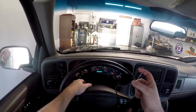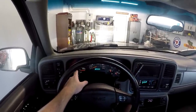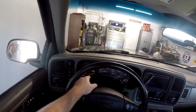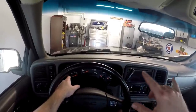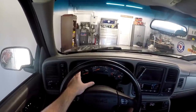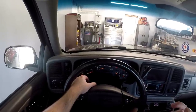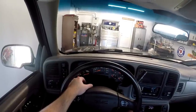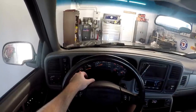There's an impact sensor up under the radiator support, and they like to corrode. So what you have to do is turn the truck off, disconnect the battery. I'll disconnect both batteries because this is a 2500 with dual 12-volt batteries. Then I'll go under the truck, take off the skid plate, disconnect the existing sensor, plug the new one in, and we should be good to go.